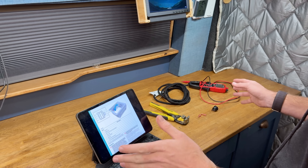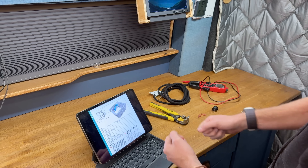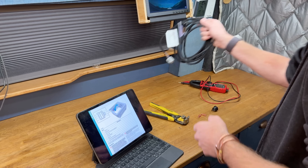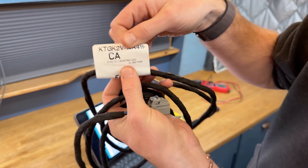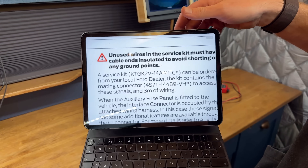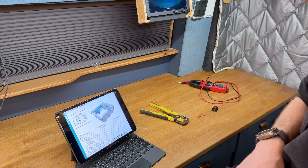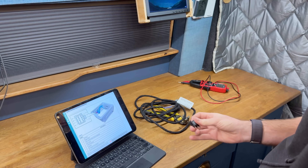If pin three's inhibitor signal is grounded, then smart regenerative charging inhibitor is enabled. You could cut the wires behind it and do it that way, but since there is a proper way of doing it, I have the cable or harness for it — which is that part code if people are interested, also mentioned in the kit list. I'm going to do it quite simply — I'm just going to put a switch on the end so I don't always have to use it, and crimp the ends of this.